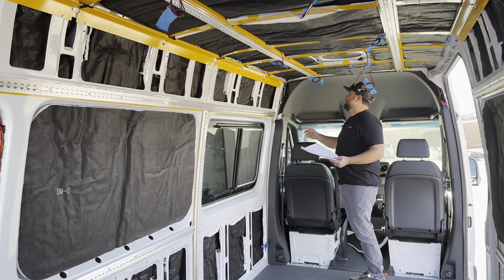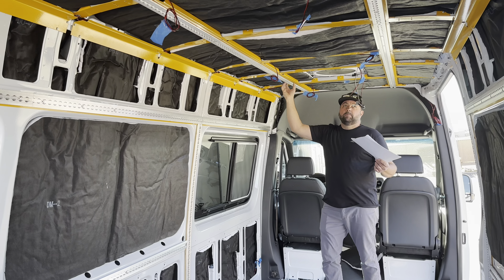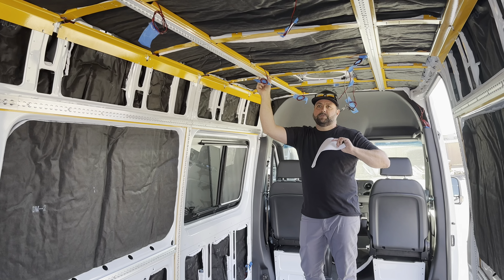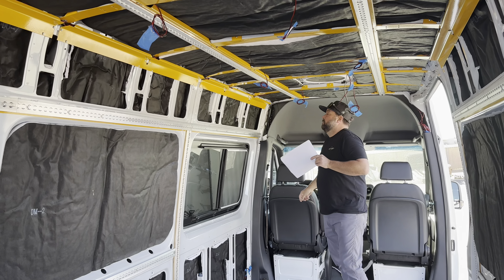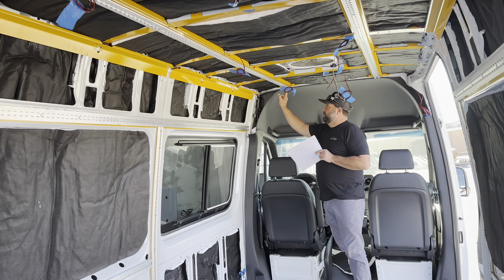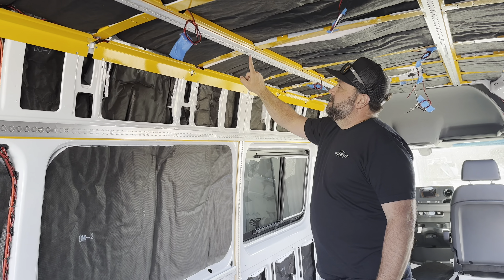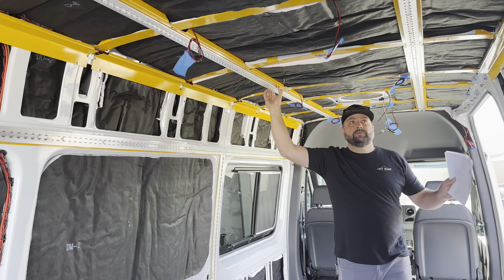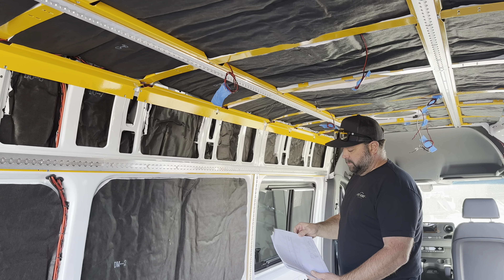For the 170 roof L-Track, the item is RF-184 Universal times two. Universal means the part works in both a 144 and a 170 — these are 84-inch pieces and you'll have two of them. The forward bolt hole facing the front of the van is in the very third full hole of the L-Track. The rear bolt hole, where your first seam will be, is in the very first hole of the L-Track. Establish those on the driver and passenger side and the rest will fall into place.